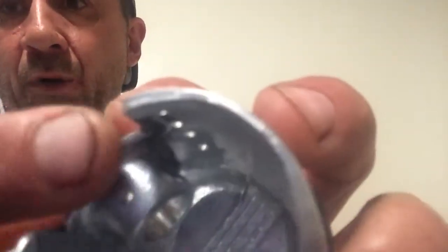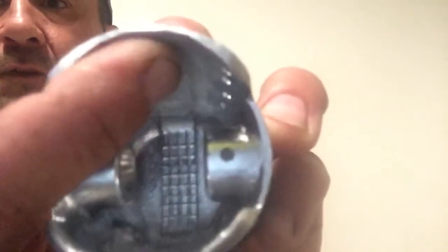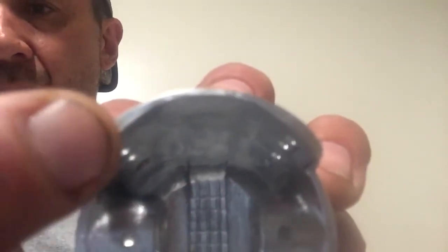On the inside, these edges here are a little heavier. I took and tapered them in and took a little bit of material out of the piston itself. There's kind of a lip here usually, so this has been tapered down so it's rounded out, and that should help to dissipate the heat. If it does draw the heat off to the sides, it's going to bring it back into where your oil holes are.